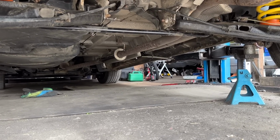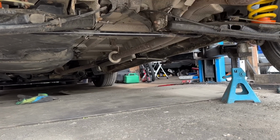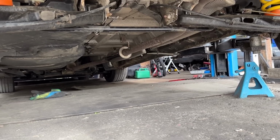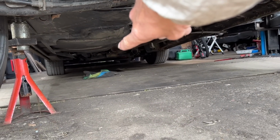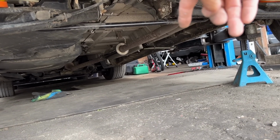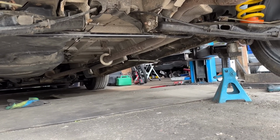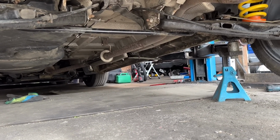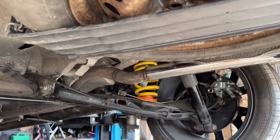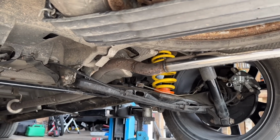So when I hung the exhaust, it tried to flop downwards. I could have just done that clamp up and it would have held it, but that would have put a twisting force on the flexi right up the front. So I did put another hanger on the other side, on the right hand side, so that way there's no twisting force on the exhaust, and yeah, it should hold it nice and solid. It is absolutely solid. If we give it the boot test, it's solid.